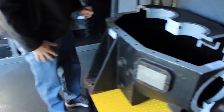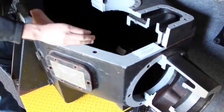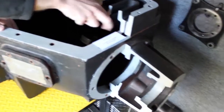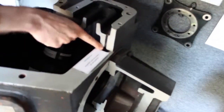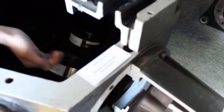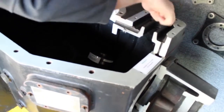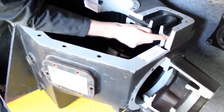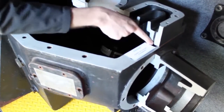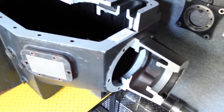And what about the Amarillo box? If you look at the Amarillo design, the only port they have feeding their pinion is right here — it's very small. They have a similar slinger design bringing oil up and it spills into this cavity reservoir, but it can only really get through this one small hole into the pinion bearing. So significantly smaller port sizes.